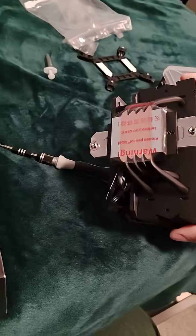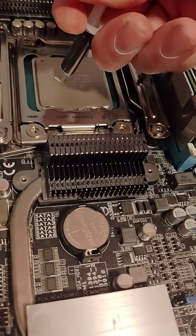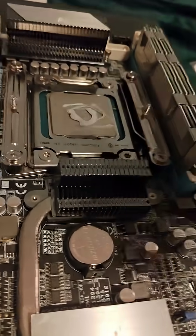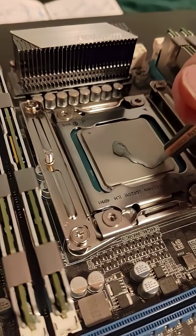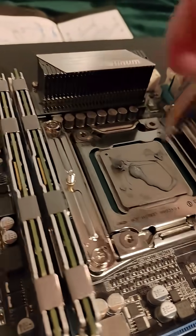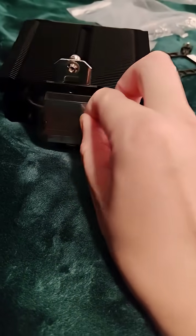All the mounting hardware is on, so now we're going to put the paste on. I'm just using the generic thermal paste that came with the cooler. Here's the paste for the second CPU — these CPUs require way more paste than regular ones because of the bigger IHS, so I'm giving it a generous amount.